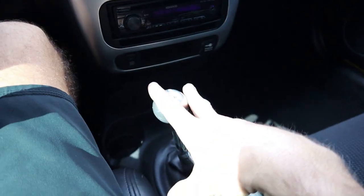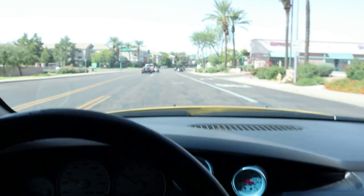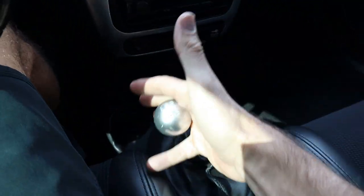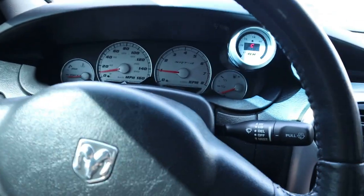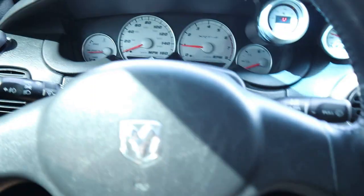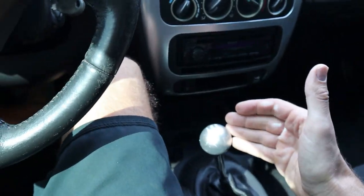Most of you already know this, but manual transmissions can be shifted without the clutch. Obviously, I still do use the clutch. Here's a good example of what's going on — coming up to the red light, I'll put the clutch in and try to get it into second. Right now it won't go into second, but it will slip in at about 10 miles an hour, and then about 5 I can slip it into first. If I don't hit it at those exact points, I've got to shut the car off and get it into gear before the light goes.